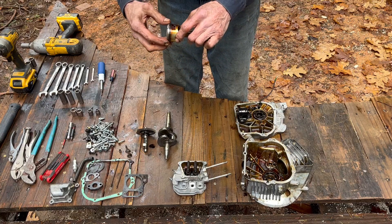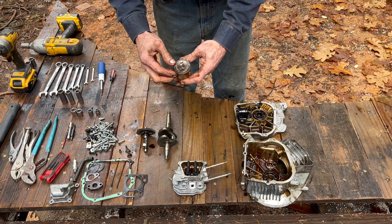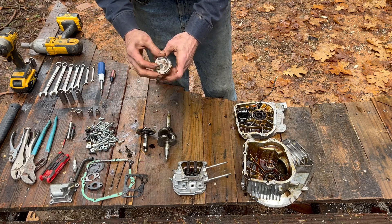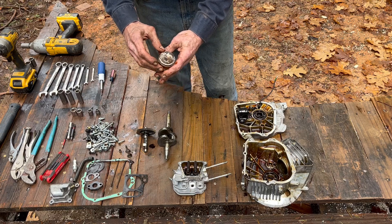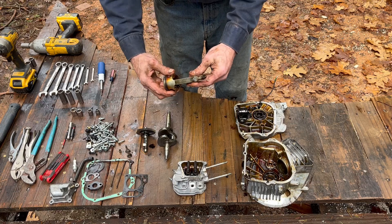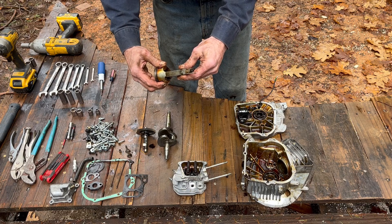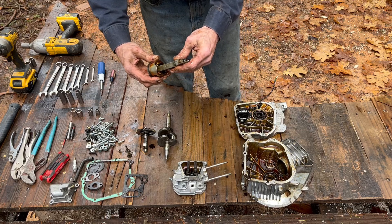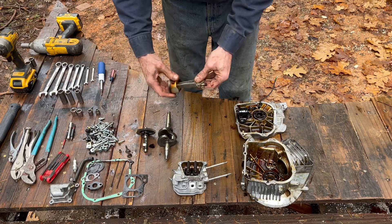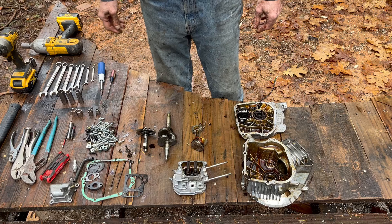The piston is obviously probably what caused this rebuild — quite a bit of wear on the valve pockets and a little pocket there for the spark plug. With all the carbon on here, that may have been part of the problem; that carbon buildup may have caused pre-ignition over time. If I rock it, I can feel a slight amount of rocking — probably near its wear limit, but not at 'Amish sawmill' territory by any means.